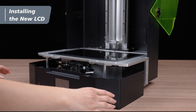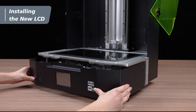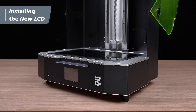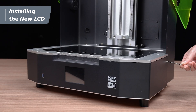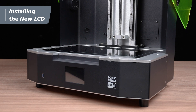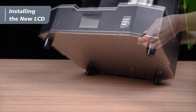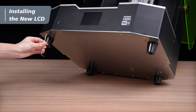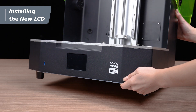Reconnect the USB extension cable to the main board. Lastly, put the front cover back in place, ensuring a snug fit with the printer, and please make sure not to pinch the cables. Use a 2mm hex key to tighten the four flat head screws on the left and right sides of the front cover. Then, use a 2.5mm hex key to tighten the eight cap screws on the top and bottom of the front cover.